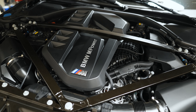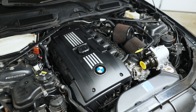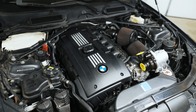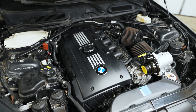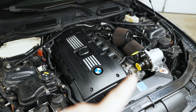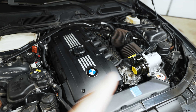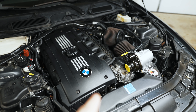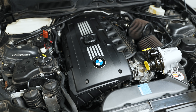Imagine you had a manual car towing something up a grade — you generate a lot of throttle input but not necessarily a lot of engine RPMs. That could lead to a lot of coolant temperature building up in the block that can't be removed fast enough, causing pre-ignition or knock. With an electronic pump, it can react by spinning faster based on coolant temperature and throttle input. The other way to handle it mechanically would be to downshift to bring RPMs up and spin the pump faster.